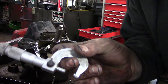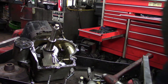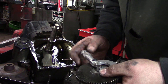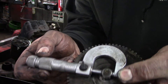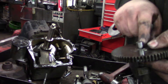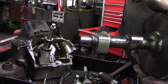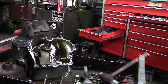496 — if you can read that. So this camshaft I showed you is out of a blown-up engine, so it's no good. Let's measure this one — right about 500, pretty close, 499. It's right in spec. Really, mainly the wear on these camshafts happens right here on the side where the gear is — that's where most of the pressure is. Now these lobes on the flathead Briggs, I've never really seen them go on a flathead. Now the overhead valve — oh yeah, they go bad. Just some things to look at there.